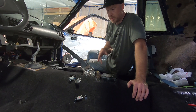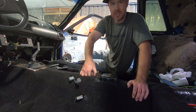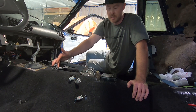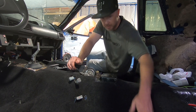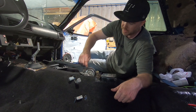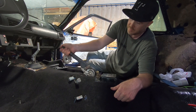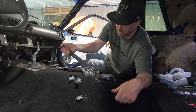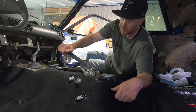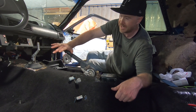I'm looking at the emergency brake. The cables actually rub on the driveshaft a little bit - you can hear that. This car has an aftermarket aluminum driveshaft, and because of its slightly bigger diameter that could be part of the issue. There is a way to modify the handle and it looks like somebody has already done that - there's a spot weld here on the gear and the release and everything works great. You essentially need to drive with the handle about here before the cables will stop rubbing on the driveshaft. Not much that can be done here.